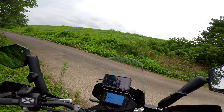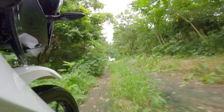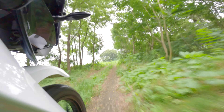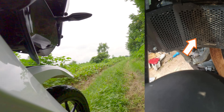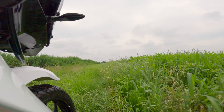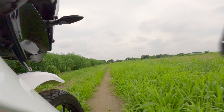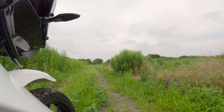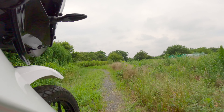This combined with a generally leaner running engine hindered the bike's ability to cool and resulted in overheating. While the high fender is certainly allowing debris to come into contact with the rad guard, a proper cleaning after every ride should prevent any major restrictions in airflow. Evidence also suggests this is a radiator guard issue more so than a fender issue, as even with a stock fender you still get mud caking onto the radiator with an aftermarket radiator guard. I do not recommend this particular Z-Tomer AliExpress rad guard, and if you are running any aftermarket rad guard — particularly with a high fender — be very diligent in cleaning out the rad guard and radiator after every single ride to prevent potential overheating issues.